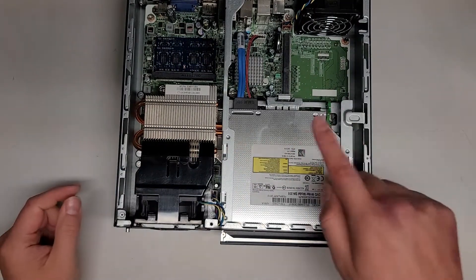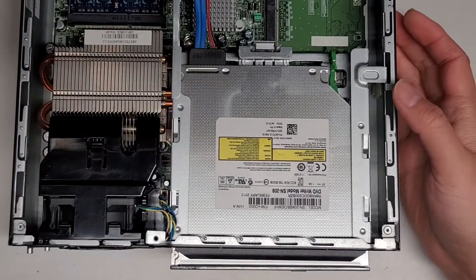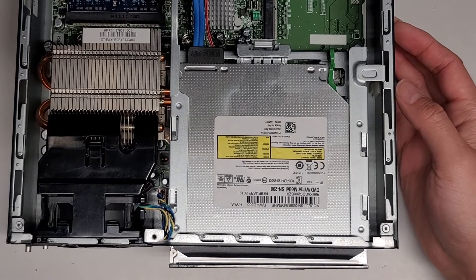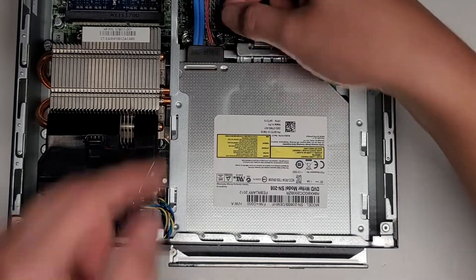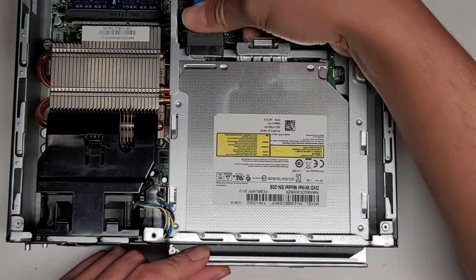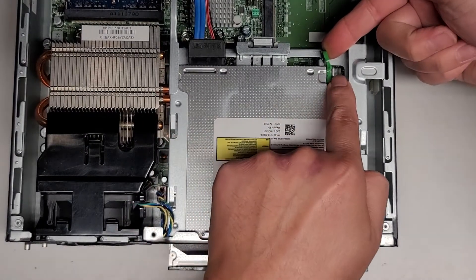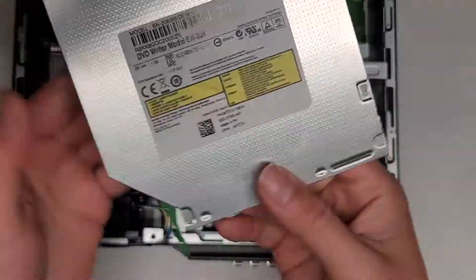Next, we're going to remove the CD drive, optical drive — whatever. This is a very standard type of drive used in laptops. So if you wanted to change this to a Blu-ray or different DVD drive, you can. We're going to first disconnect this cable — try and grab the black part of the connector — wiggle it as you pull. To remove the CD drive, there's this green latch here. Push it in quite far so it passes this metal piece, then slide it forward. And there you go, we got the drive out.